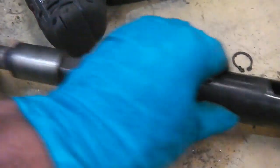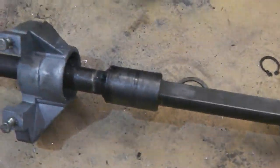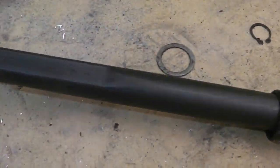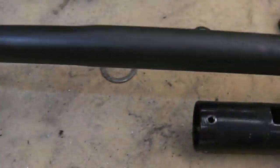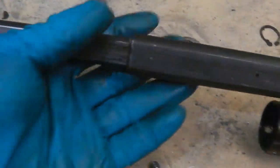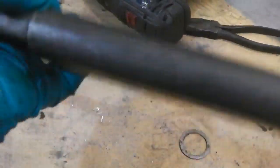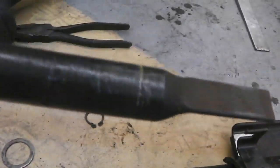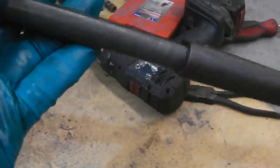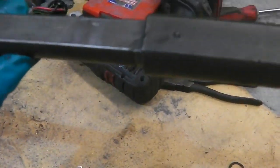This is your telescopic shaft. That'll come out like so. You can see how it would slide in and out on there. That's a set length, so you need to mark where it is, which I've done down there. I'm going to mark here, make sure that your spec for that is in the book, so you can move it and knock it into place where you want. Okay, so that's the steering shaft.